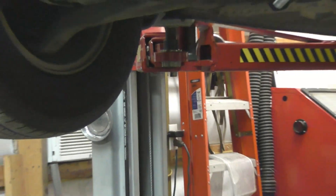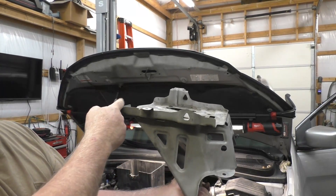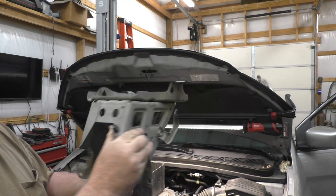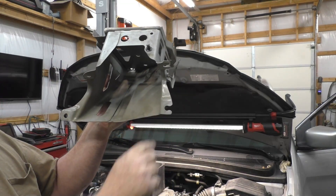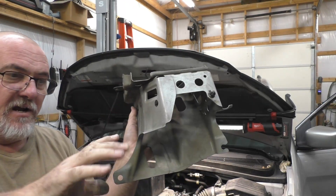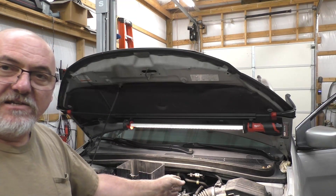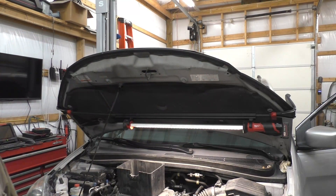I'm gonna go ahead and zoom this out. Here's that contraption — there is a wire bracket that bolts on here, there's a push-lock connector which I have to replace, and there's another one that you unclip on the other side. Those are wires fastened to it. One bolt slips in and out, one bolts solid, and these two on top bolt solid — one side is fully enclosed, the other slips in. It is easier to remove the airbox, but I left the airbox in.